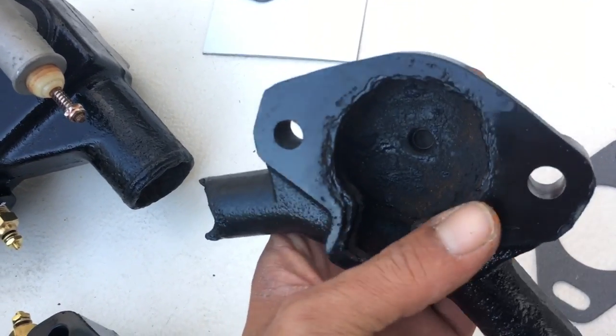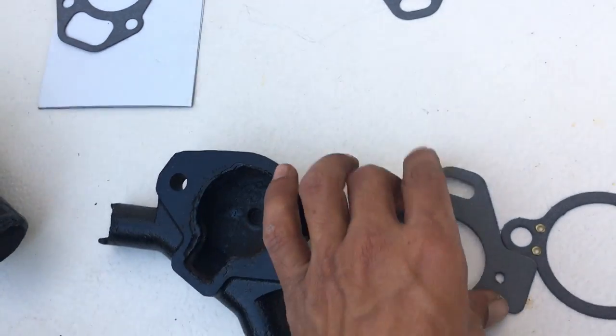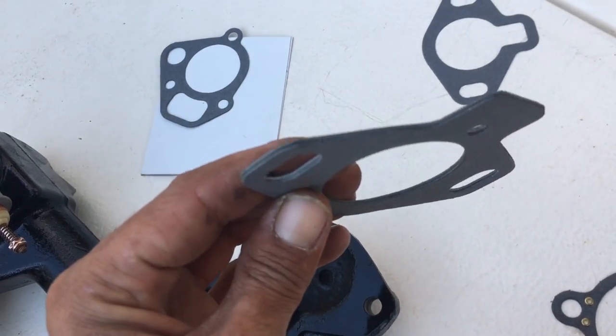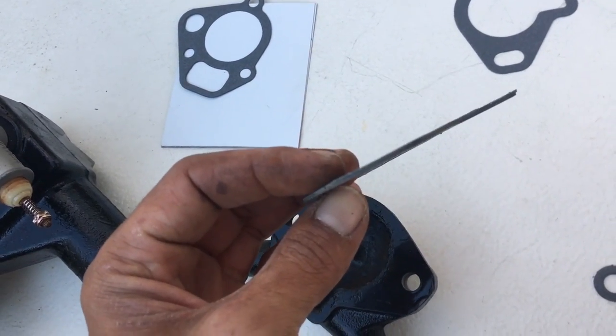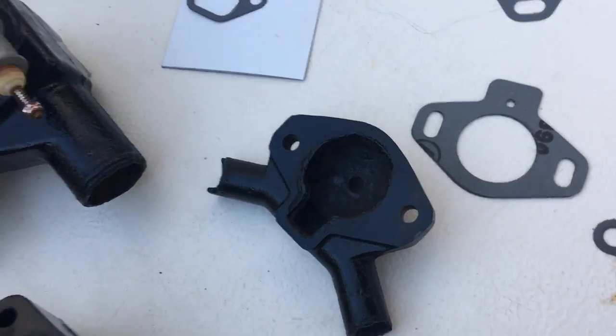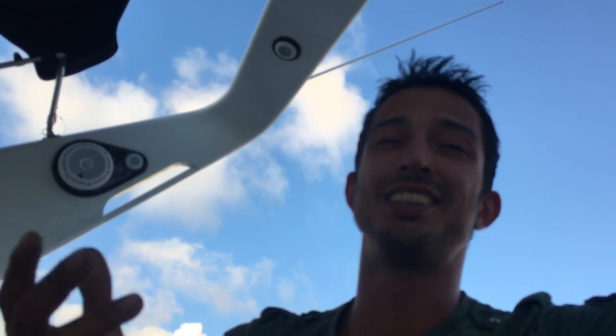Because of the condition of these caps — they're pretty worn out — once you get it to a certain spot, I'm going to use some gasket sealant. I've doubled my gasket — I sealed two gaskets together — to give more cushioning so I can tie it up and everything should be just fine. Alright guys, that was my overheating problem. Comment below if you see I'm doing anything wrong, please let me know. Thanks for watching and see you guys later.